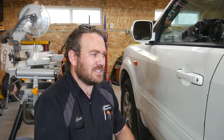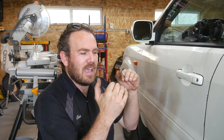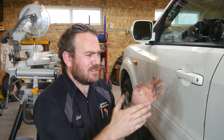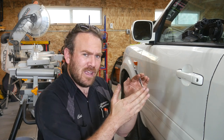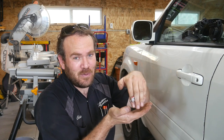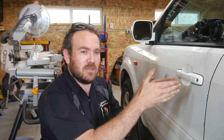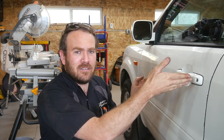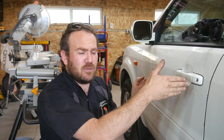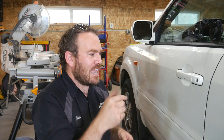And they also use a split wafer system. So instead of having a wafer that's the same on both sides, we have to pick each side, which means also another security feature of these locks is we have to pick it part way, and then we have to pick it again to go the rest of the way before we can decode it. And then when we come to go back to the neutral position, we have to pick it again because it gets stuck about an eighth of a turn. We'll have to pick it again to go back to the neutral position before we can insert a key to test this system out. So I'll move the camera around.